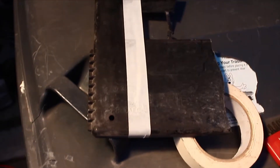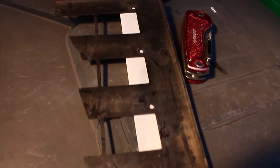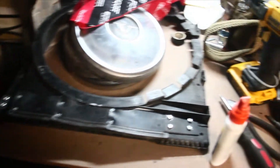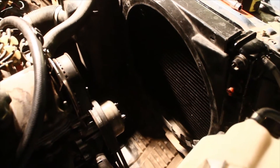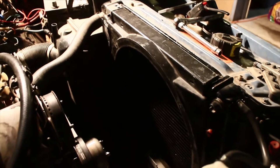Cutting the feet off the bottom of this shroud made it fit a lot better — it now goes all the way to the bottom of the radiator support and cups the top of the radiator. We're going to figure out how to attach that more permanently in a few minutes. First, let's attach the other side. The nice thing about this other portion is that it goes to the other side of the vents, so that's where we're going to do our cutting — basically subtracting the width of those little flaps. After about two hours of trimming, I have finally finished fitting it.